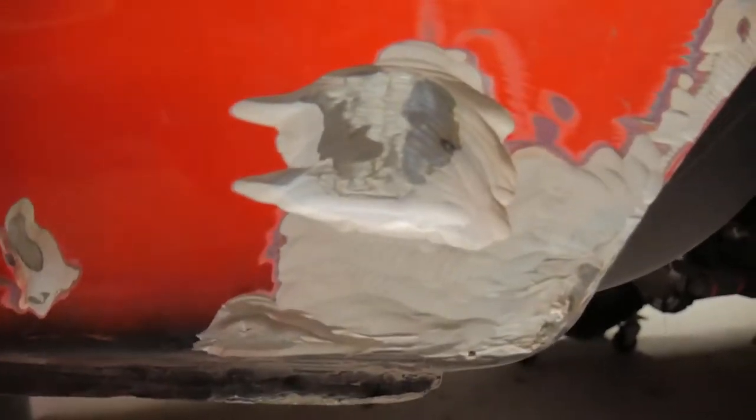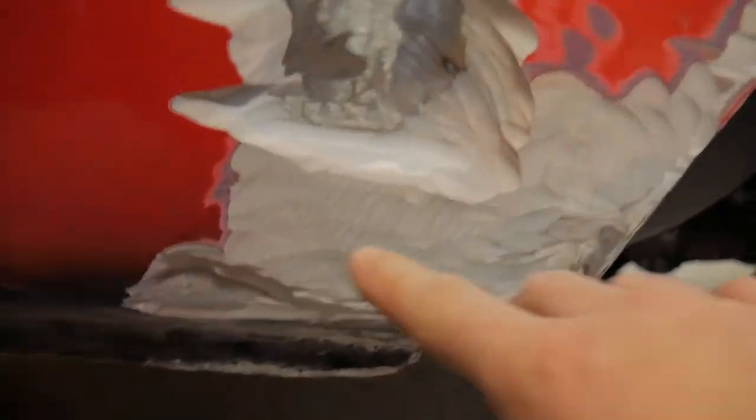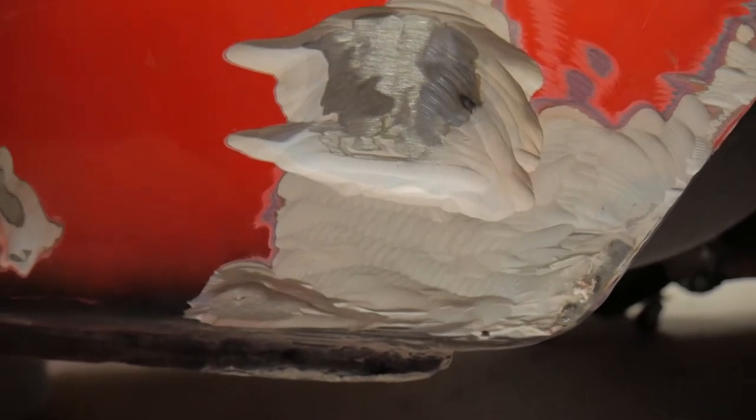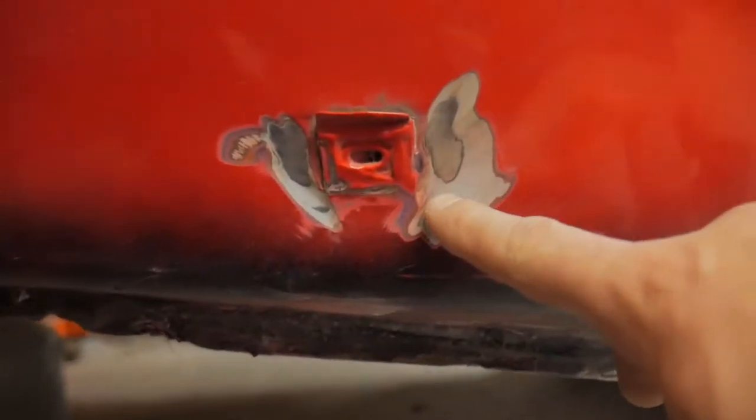After I clean this up a little bit, I did a little bit more grinding here. I don't know if you guys can get a good look at that, but that is a lot of body filler - good metal behind it, but a lot of body filler. I'm assuming right in here is where it started getting a little rusted and they built it up. Maybe it got hit and they built it up and had to level it out. If you get down here, the Bondo's not as bad.